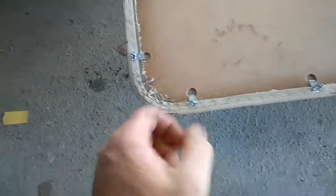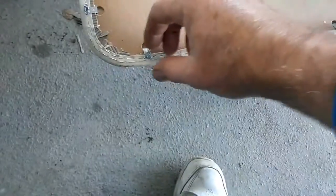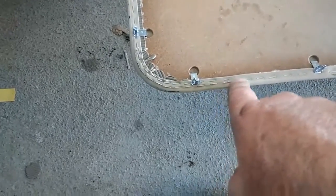Also, your door panel clips - you want to spread those open a little bit where you slide it on the wood, because it tears it up pretty badly if you don't. So spread them open a little bit, put the clips on, and make sure the clips - because on some of them you need them to go up onto this edge, which they call beading, but it's actually called welt. That's the actual upholstery term - welt around the edge.